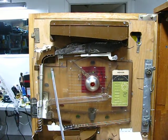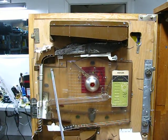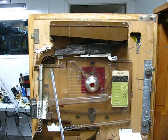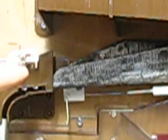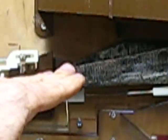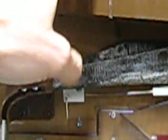Before I started this video, I filled the hopper back up with balls. Right now it's filled with balls, and you're asking yourself, well, why isn't it paying out right now? The reason is because of this mechanism right here — it's a gate — and its job is to keep the balls in the hopper and this trough until they're needed by the machine. There's a lever on this gate that you can use to manually lock out the balls, say if you were going to work on the machine in a pachinko parlor and didn't want the balls flowing all over the floor.